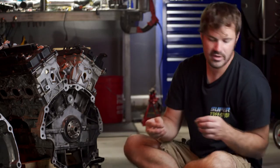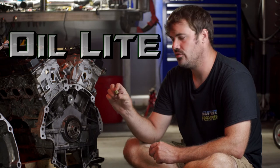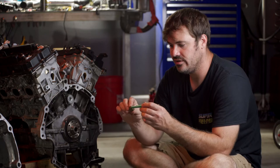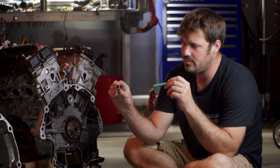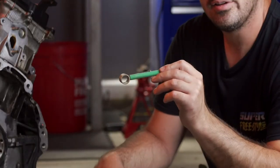The one I have in my hand is actually an OEM one. I have another one here that came with an aftermarket clutch kit — I'm not going to name any names because all of them seem to be pretty consistent. The original one from Nissan is made out of a material called oilite — it's oil-impregnated brass. Brass is not magnetic, so this is a really easy way to identify whether you even have oilite or not. The one that came in the aftermarket clutch kit is magnetic, and that is definitely wrong.